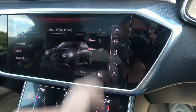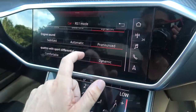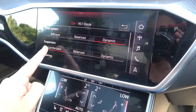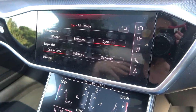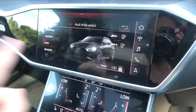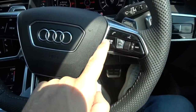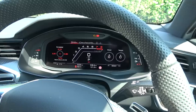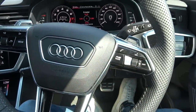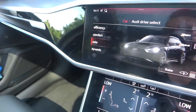In RS1 I've set everything to dynamic - drive system, suspension, and everything else on dynamic, pronounced, or sport - except for ride quality, which I've kept in soft because British B-roads aren't that great, but I still want the faster throttle response, gear shifts, and handling. Once saved, you don't have to go into the menu to activate it. The RS1 and RS2 settings are saved to the RS mode button on your steering wheel - press once for RS1, again for RS2, and a third time to return to normal. It's a great way to jump quickly to your preferred settings.